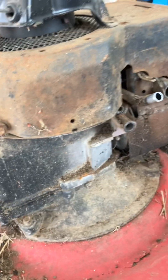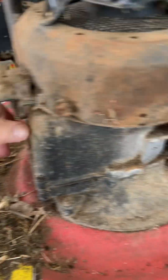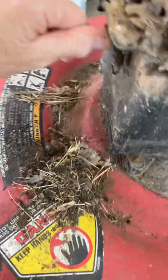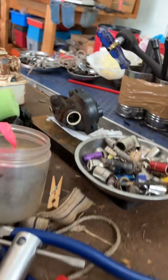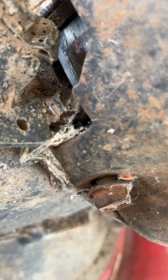Now I'll be able to move this kill switch back and forth so I can at least pull the cord. I've removed the cover, so now I'll be able to move this and get it out of the way — but that cable is so frozen and stiff I'm going to have to get that off of there. I need to grab that and get it to go down because that's keeping me from being able to operate this kill switch.